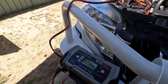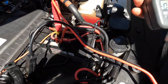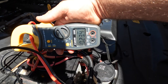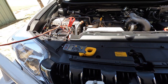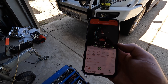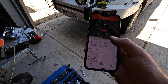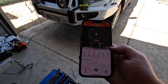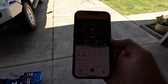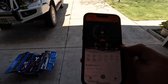The charger is on - it's charging at 12.9 volts and the current is 23.4 amps. When I look at the BMS on the phone it's about the same. The BMS app is telling us 23.6 amps coming in at 12.9 volts. It also gives details of a couple of different internal temperatures and a gauge showing the amount of power, which is slowly climbing up. I might drop the charger down to 16 amps and let it charge up a bit slower.